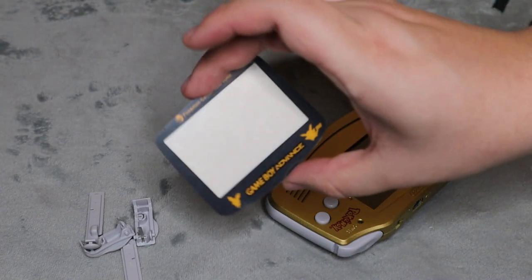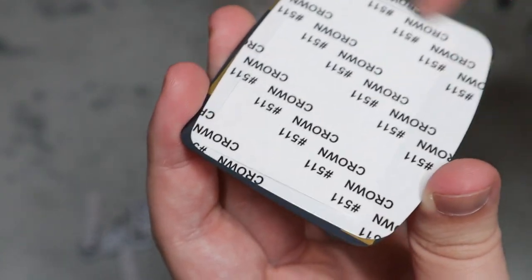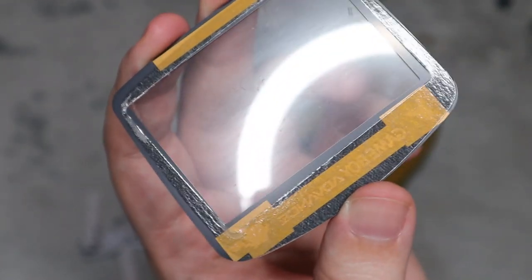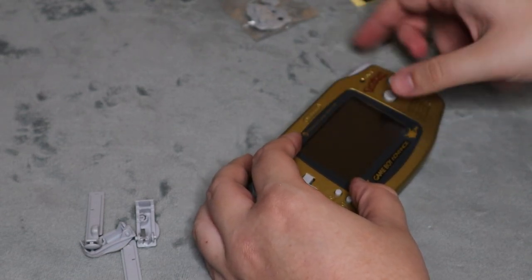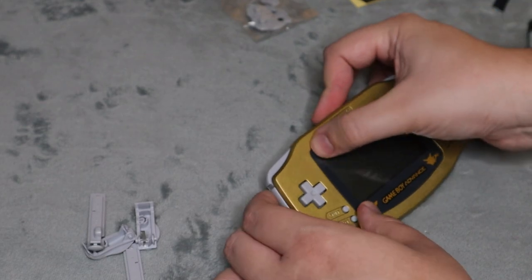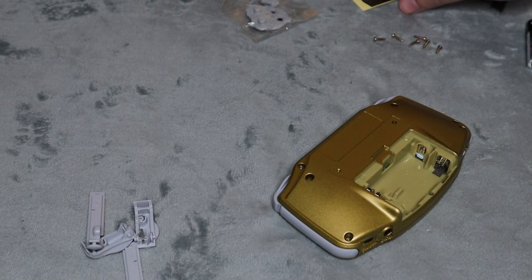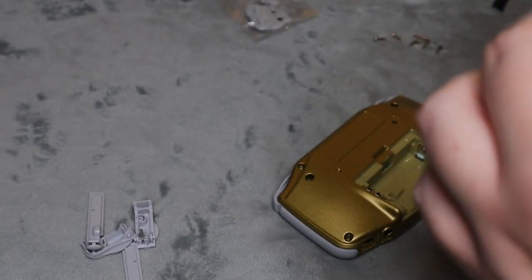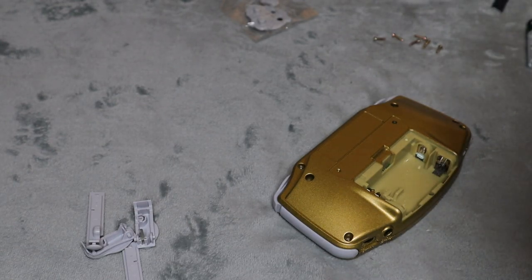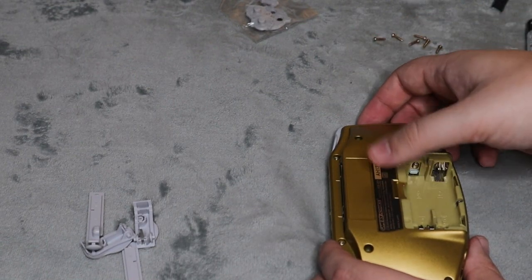And you're going to replace the little screen protector. On this you can actually see — it's hard to tell on camera, but there is a little cut-out here. You're going to take that out, but you're going to leave a gasket around it, just like the other one we did. Then you're going to push it onto the screen. So just like that, we took the wrapper off, but you can see there's a clear adhesive border around it. So you're just going to turn it upside down and press it firmly in, pushing all of the edges in to secure that adhesive. Then we're going to turn it back over and put the sticker on here. Mine did come with a replacement sticker — it's better to get a kit that has everything with it. Just going to put the sticker on like that and push it on.